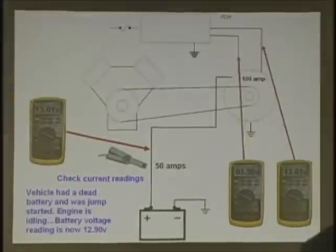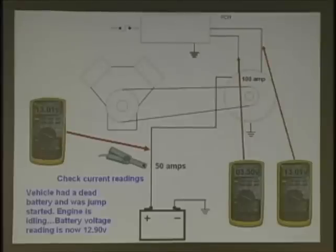Now, you don't have that luxury. Nowadays, to do that, you got to look at this. They don't make all that stuff anymore, but in newer cars, you're looking at these wires. How are you going to full field this baby? Scan tool. Scan tool? Crank the compressor or lights on. Ground the compressor? No, the AC compressor on or lights on to make the computer react, you know.